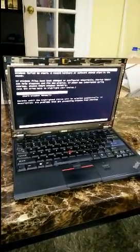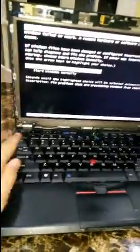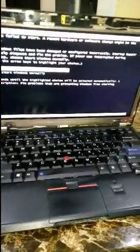Okay, and once you've installed the 4 screws again, you probably want to test it first like I'm doing right now, just to make sure the screen works and check for dead pixels and stuff like that. And then all you have to do is reinstall the bezel with the 2 side screws that we uninstalled first, and you're done.